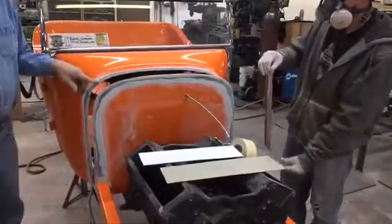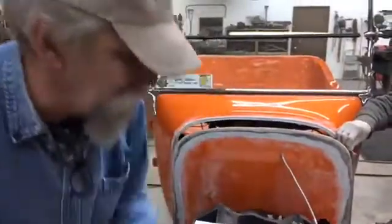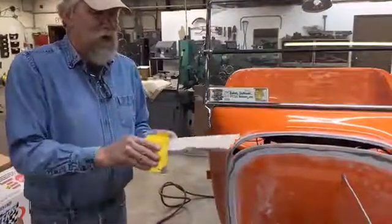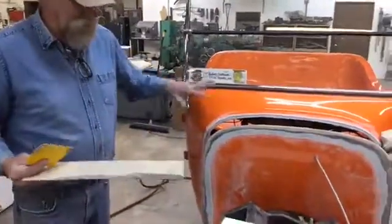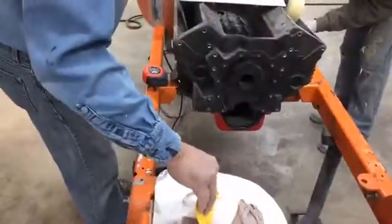Before I prepped this, I made sure all the paint was off. So all I'm going to be bonding to is fiberglass. That polyester fiberglass is the material in between. This is fiberglass right here, and what holds it together is actually a polyester resin. Once that's activated, if you put it on this paint, there's a good chance it's just not going to stick well. It's going to soften that paint, so just go back onto fiberglass. Grind it down, sand it down. I sanded the back of this. I sanded the front of this. This is white because it's gel coat, which is a polyester.